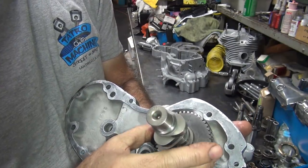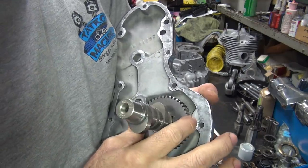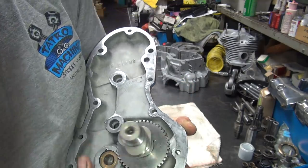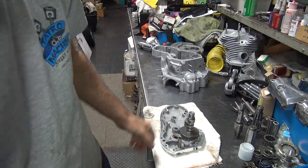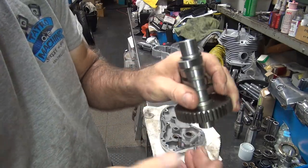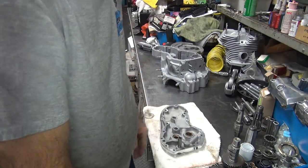If you can feel side to side clearance, that means you've got two or three thou in there at least. When you're doing the wiggle-wiggle like this, it's hard to tell — it could be out of round, barrel shaped, but it would be tight when you do this test. In this case it's loose a little bit up and down, which is the direction it has all the pressure. So if this is going like this, that can give you a little bit of tapping noise — sound like loose valves. That's where these noises come from. It's not just in the teeth like everybody says. If this is moving up and down, obviously the teeth are going to get looser.